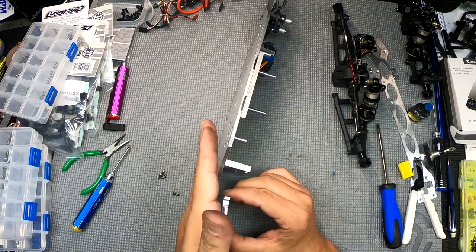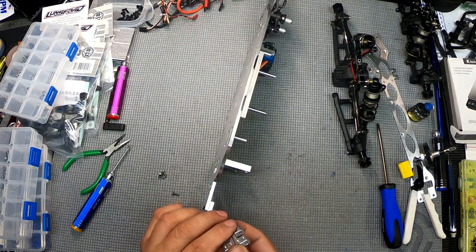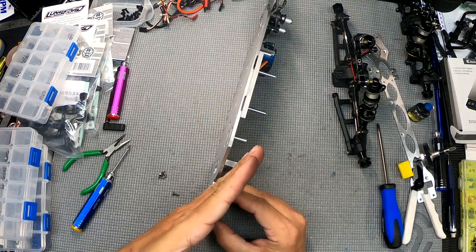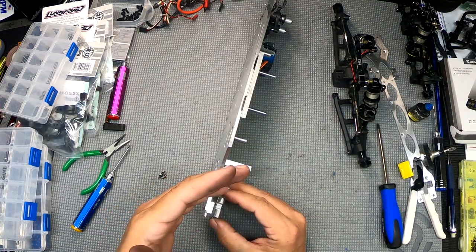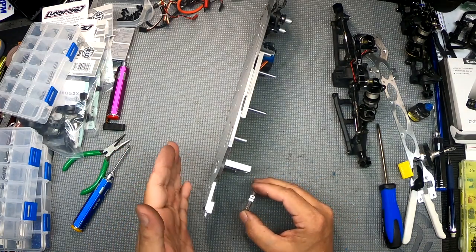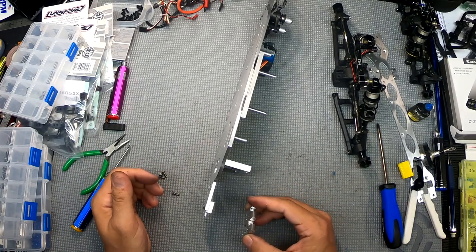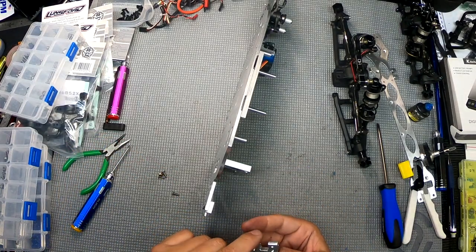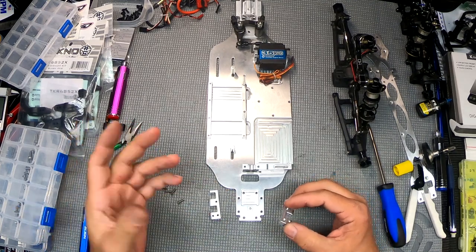The angle of the pinions is down in the front. You can orient them this way or this way, and this is the way we want - we want the equivalent of a little bit of caster. I paused the video and looked at a couple of my books on suspension to figure out what's the best direction to put these. I was 99% sure but I wanted to check.